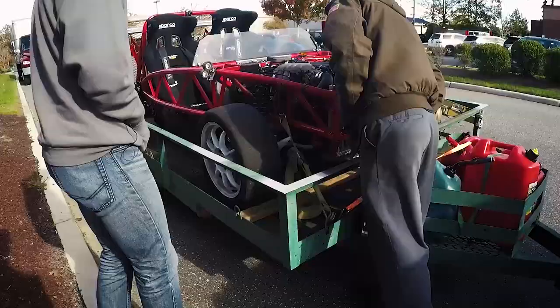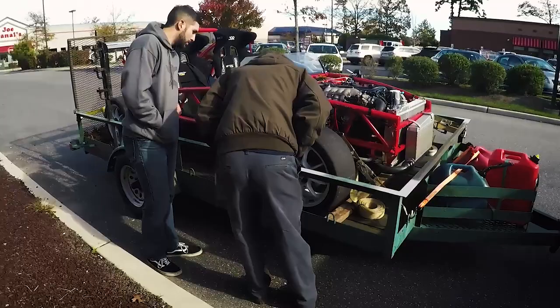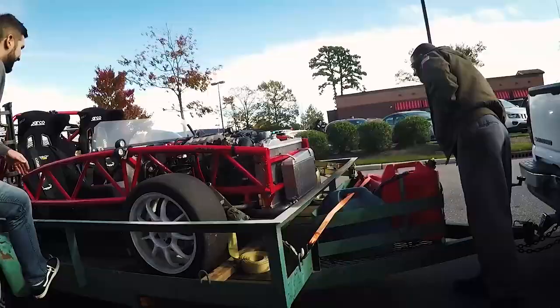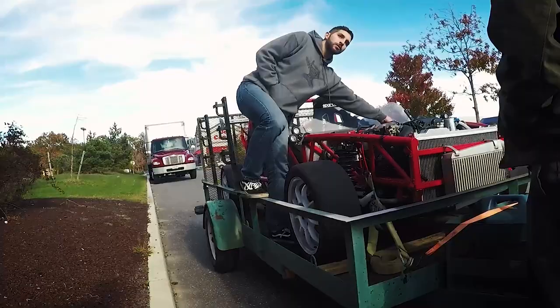Adjustment for camber and stuff? It's got the same lower control arms as a Miata, so I don't know how much you can get out of them. I just need the toe to be zero and max even camber between the two. I'm trying to race it in Millville, and they have autocross in Atlantic City about once a month.